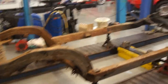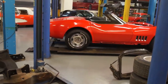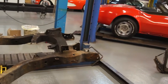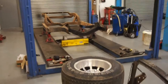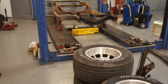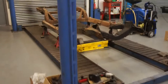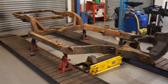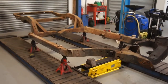Your empty chassis is in here — very productive. We're going to call a halt on yours for a little while. I want to get the body off this red '68 and give that the same treatment over the next couple of days — strip the chassis and everything. Then we'll steam clean everything together, and yours will go off for sandblasting on Tuesday. When they bring that back we'll swap over and they'll take the '68 chassis. It's all a bit of a shock to the system coming back after a restful couple of weeks over Christmas — really made a mess of my freshly painted floor! But I'm pleased with the progress. Everything was seized and needed heat, but it's all come apart in the end.